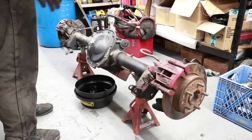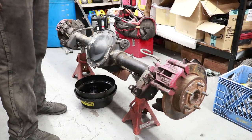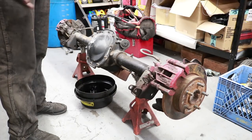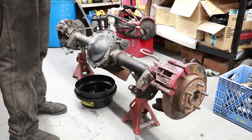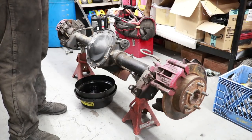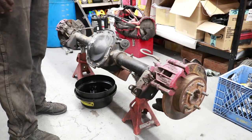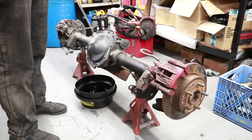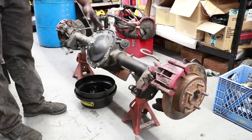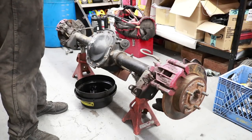Now that we've pulled the axles from the Aerostar and the Ranger, we're dealing with the housing — this is an SN95 housing from a '96 Mustang. We got this because it has disc brakes. Technically you could leave the original axles on and just bolt it in; it'll have a little more outward offset because the axles are longer, but not enough to really notice. However, the customer wants Fox-length axles because of his wheels, so that's where the Aerostar and Ranger axles come in. We're going to take the cover off to access the C-clips, remove the calipers and rotors, then pull the axles out.